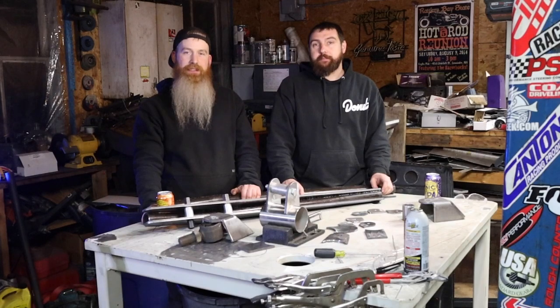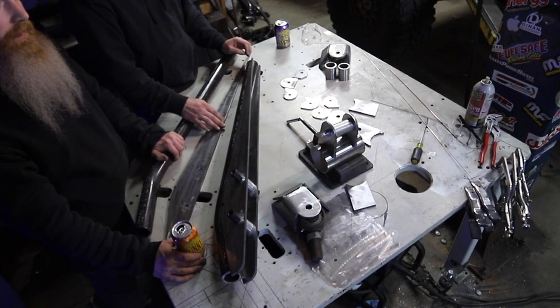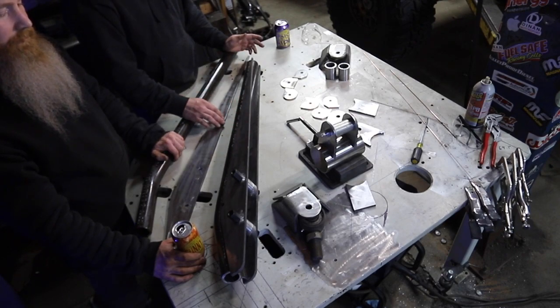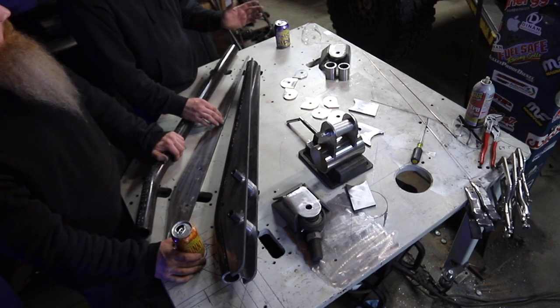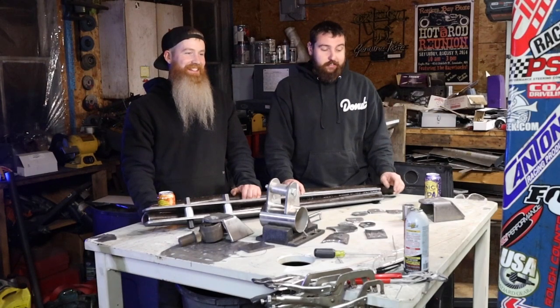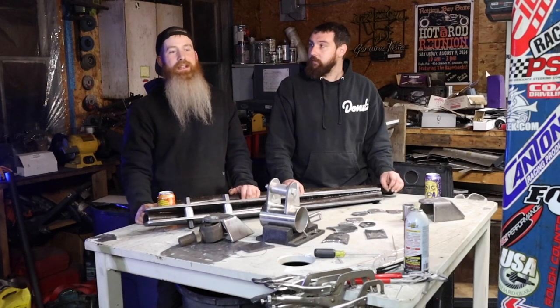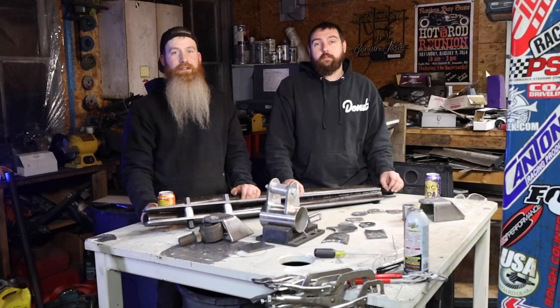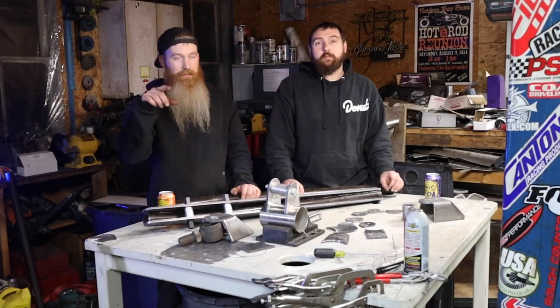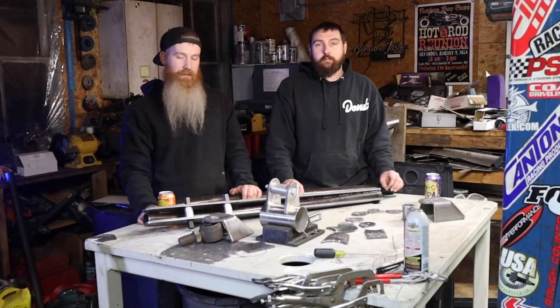With some sadness, Mike Day's time on the Super Trooper is coming to an end. I only had a few days here, but it's always a great time building stuff in the shop. We designed some parts in Fusion 360 — very capable, although completely abstract coming from SolidWorks, and using a Mac with no mouse on top of it. All things considered, doing that with just tape measure stuff, we got a fair amount of things cut and fit pretty well. We focused on the rear suspension, and in order to get that to happen we had to fit the tire all the way up into the wheel well — which it wouldn't do at the full bump location we wanted to run. We had to cut the body away so we could fit the tire and get measurements off of that. Steve Shepard came by and did some sheet metal work to piece that back together while Mike and I focused on the rear suspension bits.